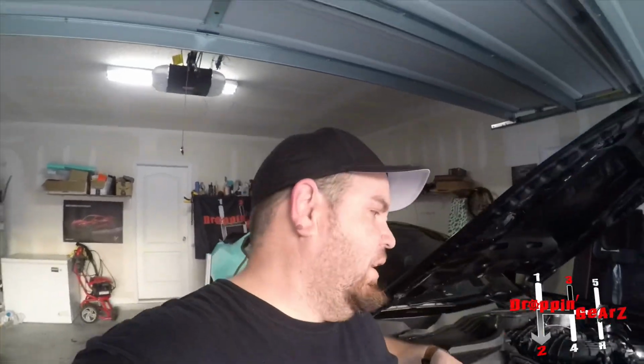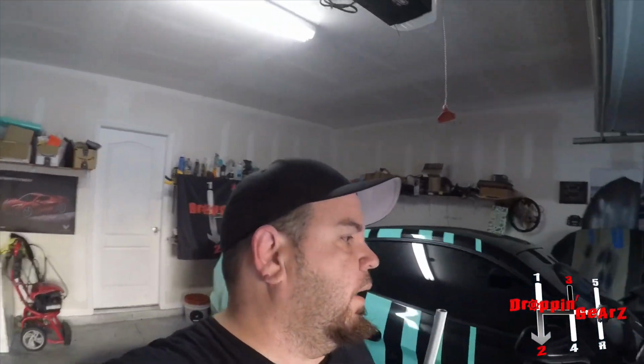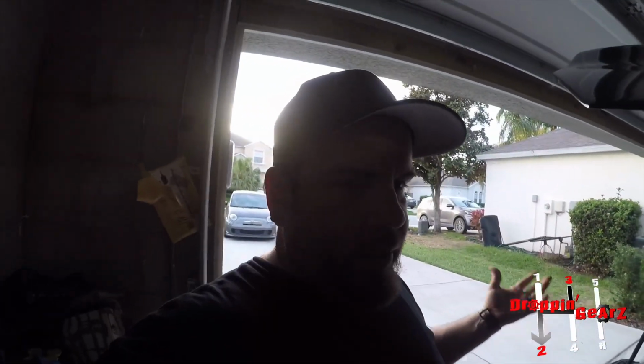Even at tuning, the car was still smoking. The first time it got put on the dyno at Cato Space, he sent me a picture of it, and it was just full of smoke. His whole shop was full of smoke, because there was so much oil built up in the turbos from the one dyno pull, and they were just full of oil from the time they started. I was worried that the turbos had gotten damaged and it blew out the seals, but the turbos were fine. And the oil problems, there are no oil problems anymore. Oil problems have gone away. So that's where we're at with the turbo kit.